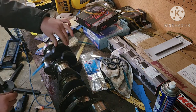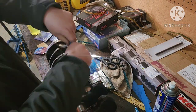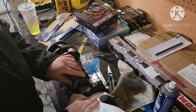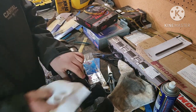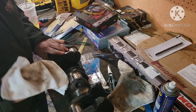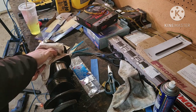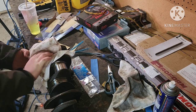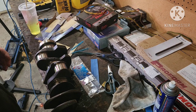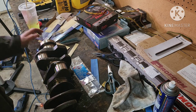I don't have an air compressor, so I'm just going to use a brush and get what I can out. Got a new rag, and just like before, just kind of wipe all the excess and all the dirt that you pulled out of those passages. You can see into the passages a little bit, and they all look nice and clean now, which is exactly what we want. What's nice about using WD-40 is even though I've wiped this all off, there's still going to be a film of WD-40 left on all the journals and inside all the ports we just cleaned out.